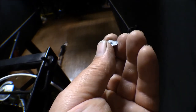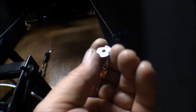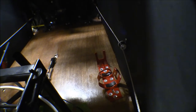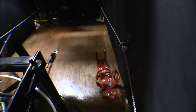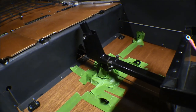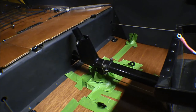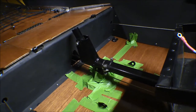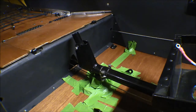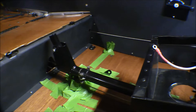I took a bunch of those T-nuts and the ones I've used in the airplane — I've got a few left — and the ones I just put in down there I powder coated. So they should be pretty rust resistant; they're galvanized and then powder coated. I also put tape over the holes through the floorboards. I've already lost a couple of washers and screws down through that floor, and I'm using stainless steel so you can't fish them out with a magnet. I figured I'd prevent any further incidents like that and taped off all those holes.